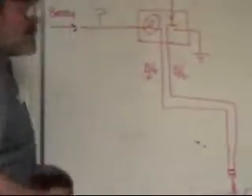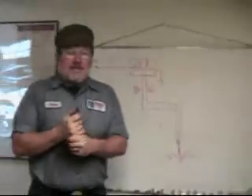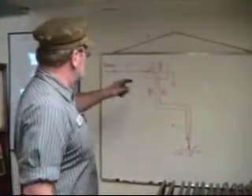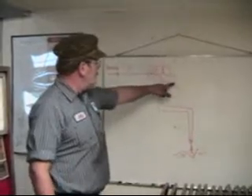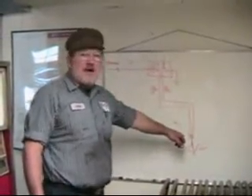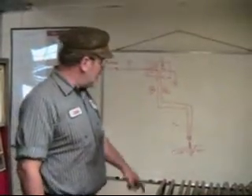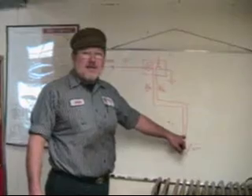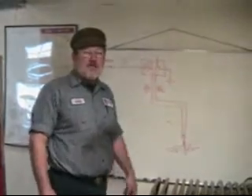So it's not an essential piece of your car — you don't have to have it. But if you want it to work correctly, you want to make sure that the bulb is good, the ground is good, and then our two black with white wires down to the shuttle valve are connected correctly. Remember, this does have a little junction down there inside the switch on the shuttle valve.